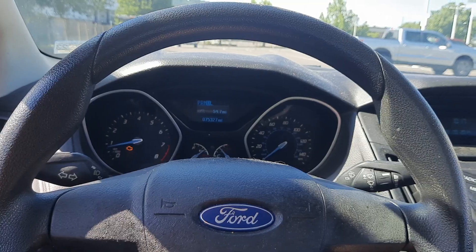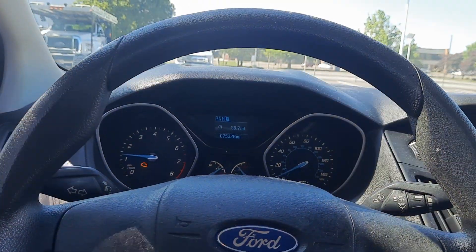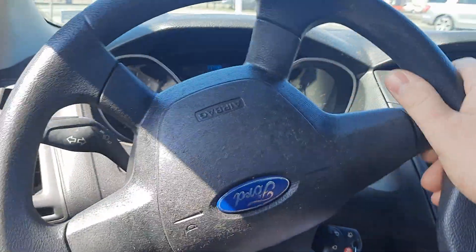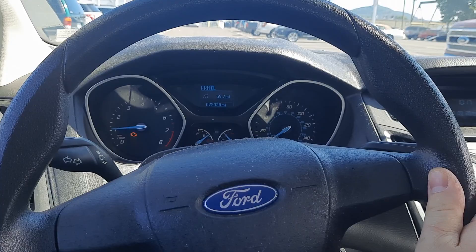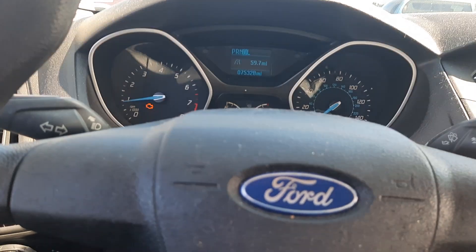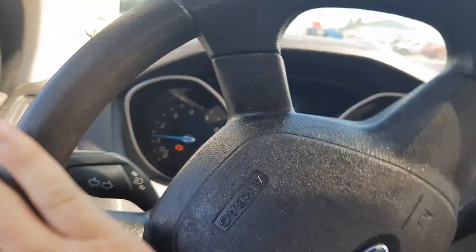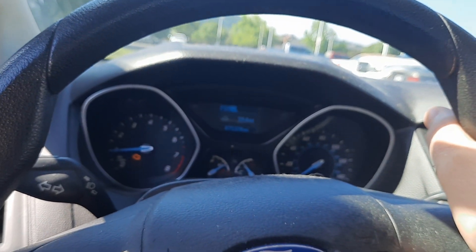Something's acting up. I'm in drive, first gear — watch this. It's kind of hesitating a lot. I do detect a burnt clutch odor as well. I also noticed the traction control light come on. It's bucking and jerking a lot. At one point it completely lost engagement and was revving really high. Surprised it's not doing it this time.